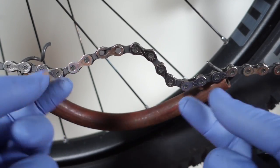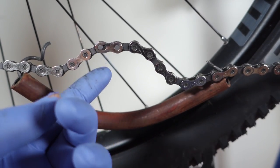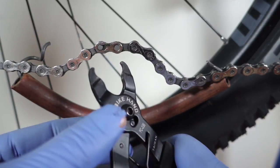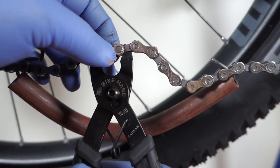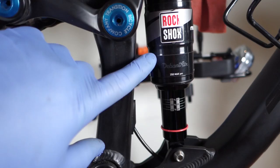The high-tech tool used in this procedure is a piece of wire that gives you this little loop on the chain. This is a specialized quick link remover pliers, but needle nose pliers can be used as well, just to apply a bit of pressure on the side plates of this power link, then disconnect it using the tool.